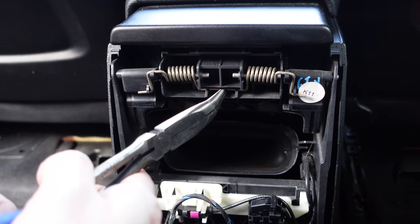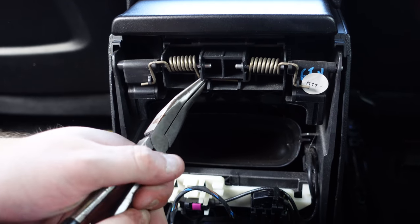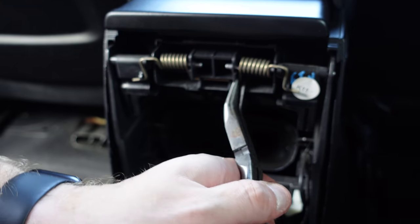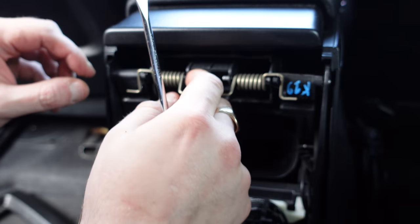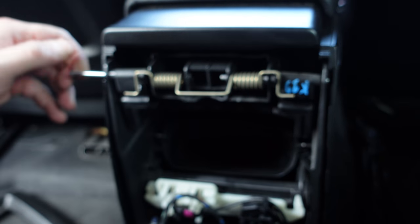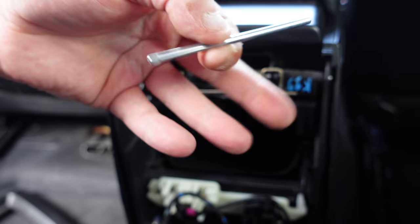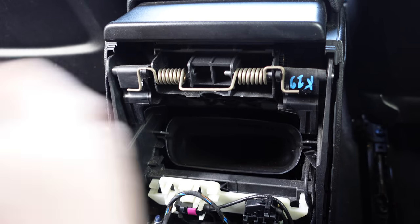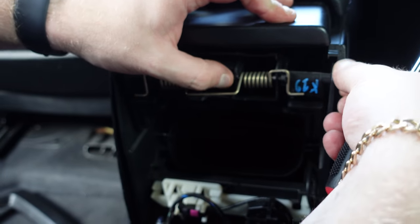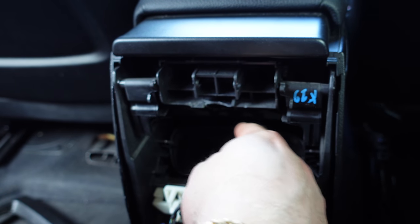So now I'm going to try and get my pliers in there to release it. Just like that. You are going to want to push the slide pins out on the side and pull them out and put them away. When you put them back, you are going to want to put them back just this way — just slope back in. You want to push the other one out as well, just like that. Now you do want to keep these safe, as you are going to need to reinsert them after.